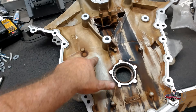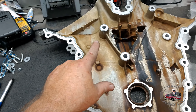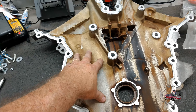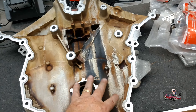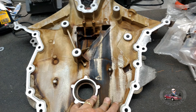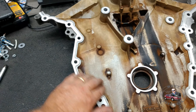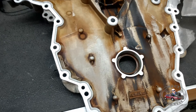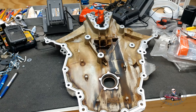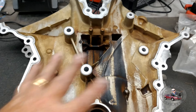This area here was cleaned with brake cleaner — it took some of the varnish off but made it all dry. Then we tried carburetor and throttle body cleaner, which did a better job. But then we used the Big Wipe and it cleaned it best. So that liquid in the Big Wipes — put it on a rag — it will clean varnish off of parts.